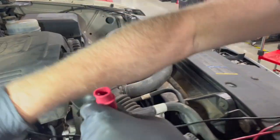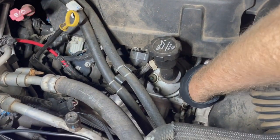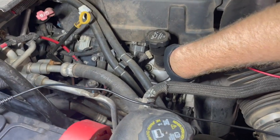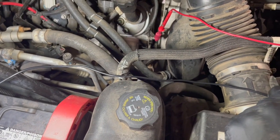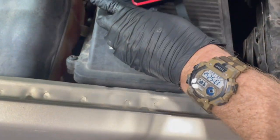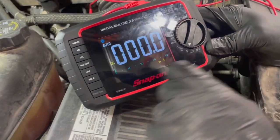We're going to hook up one lead to the negative battery cable over here, and then hook the other lead up to the other end of the negative battery cable at the block — it actually connects to that jump stud right there. So we're putting our meter on either side of that conductor — either side of this negative battery cable. Our multimeter should be pretty well zeroed out, showing there's no voltage potential difference between those two leads.